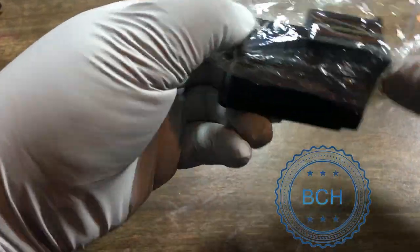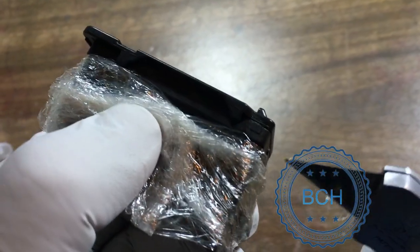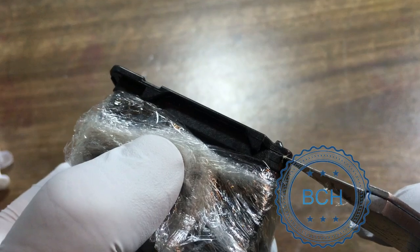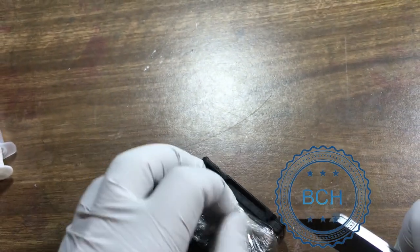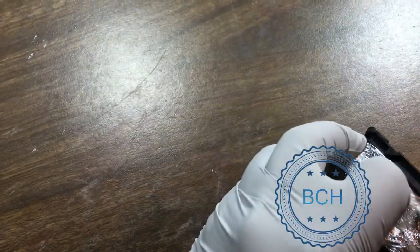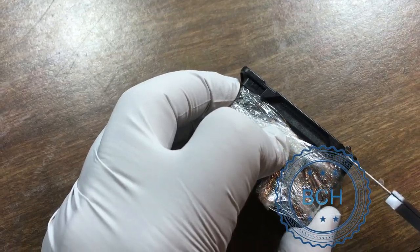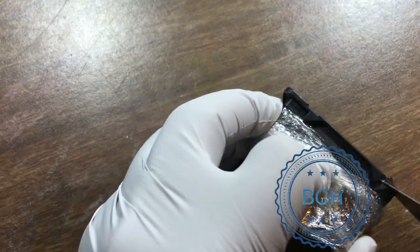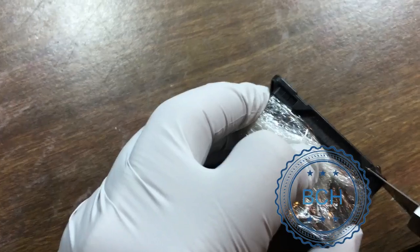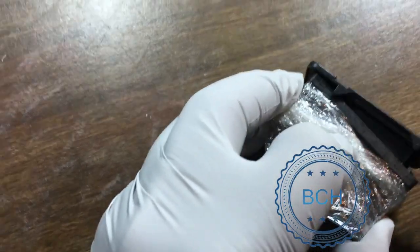Use a piece of saran wrap to cover up the print head. Find the seam between the cartridge and cover. Put the cartridge on the table and push the knife down on the seam. The cover should come off easily — not as easy as cutting butter but not too much harder. Use the middle of the knife as a pivot, tilt the knife up and down, and work your way gradually.